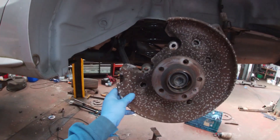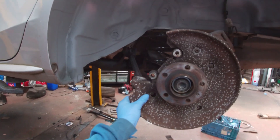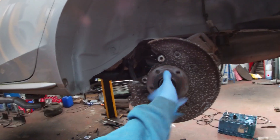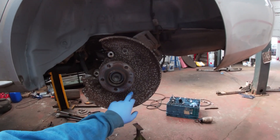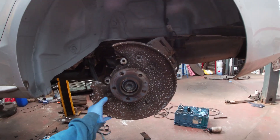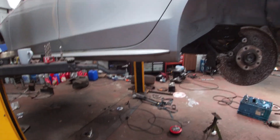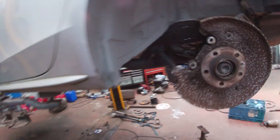That's meant to locate in there like so — that's the wheel bearing itself, feels okay. So we've painted all there. We need to get these off. We've got new ones, or we'll put some washers on for the time being. It does need pads in it so we'll need to strip it all back down. We've got the new bolts, pins, slides, all that kind of stuff. We should be able to service it again, but we've put it all together just to make it mobile.